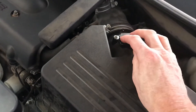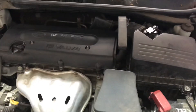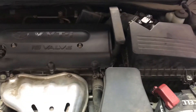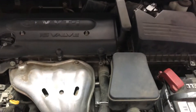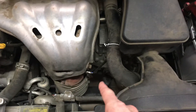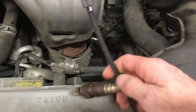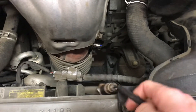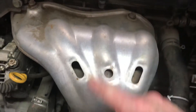After taking out those two screws, plugging the new one in, and cleaning it out to make sure there were no leaves or debris, I cleared the code again with my reader. I drove another 50 to 60 miles over multiple days and multiple cycles, and the check engine light came back on again. After doing the PCV valve and the mass air flow sensor, my next guess was the front oxygen sensor.